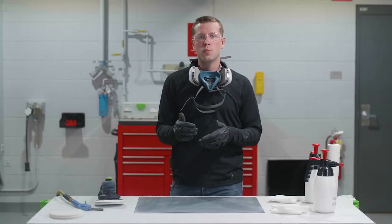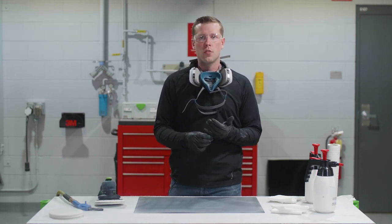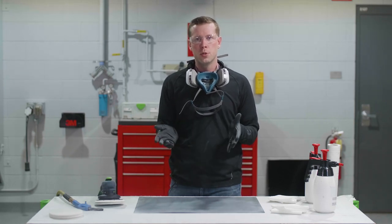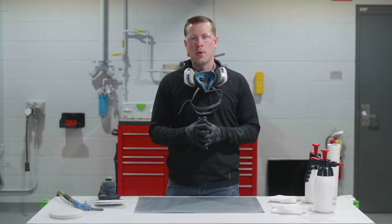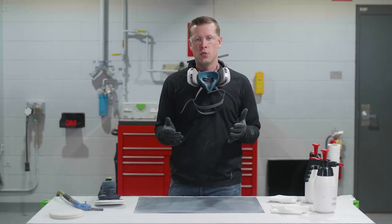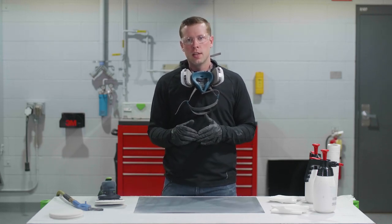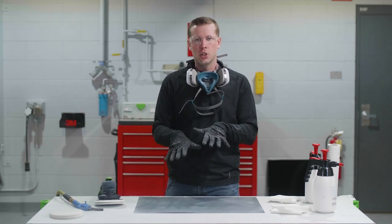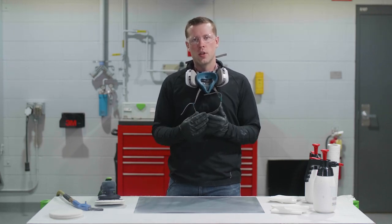At this point we're ready to move on to our actual cleaning step. We're going to start out with a water-based cleaner and follow up with a solvent-based cleaner. We stress that you follow your paint company's recommendation when it comes to the cleaners to be used. One important thing to keep in mind is that we want to wipe until completely dry — this becomes very critical. It ensures we remove all the contaminants on the surface, and if we don't, we can have clouding or hazing that could be visible even after spraying clear coat on dark colors.